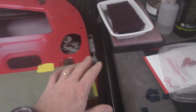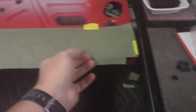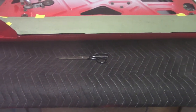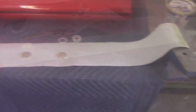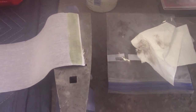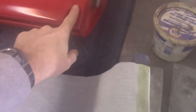I've got a paper template here to make the new vinyl cover using the stuff I got from Newton Commercial. I'm going to go ahead and trace this piece out, give myself a little extra room on either side for mistake room, then cut it and see how it goes. I've got the piece of vinyl here that I'm going to put on the top cap of the door. I've got some adhesive down — you set it up for about 15 minutes, so I'll give it a couple more minutes and then fold this piece over. That'll go in this divot and give me a nice clean edge.